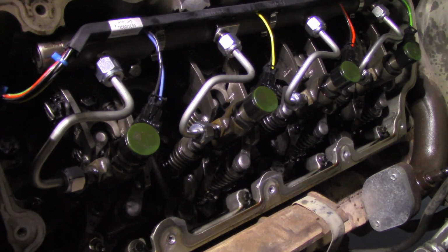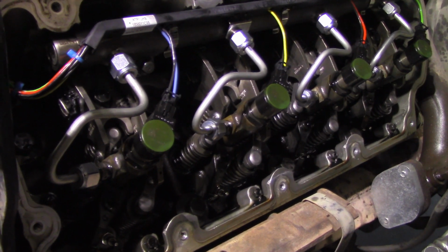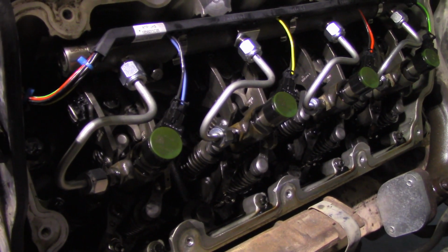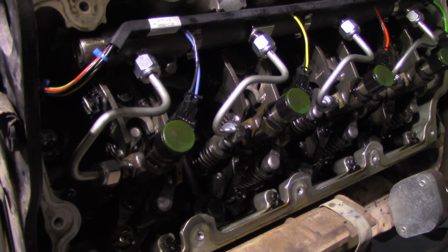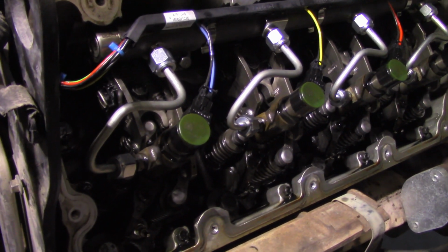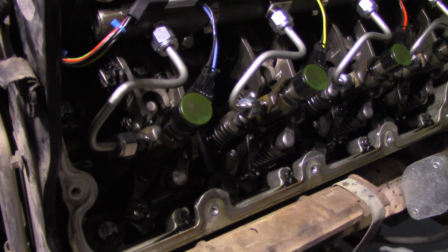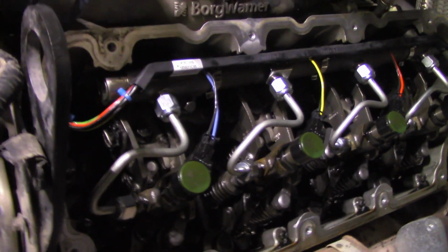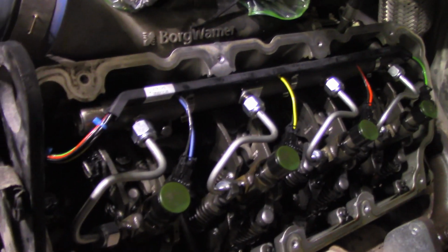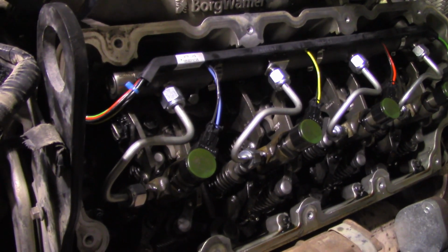So you go down to the crank pulley. There's 4 bolts in the crank pulley. There's no center bolt. There's 4 bolts, and you'll see a little roll pin hole with a roll pin in it. What you want to do is put that roll pin at 10:30 as you're looking back at the truck. So if you're standing in front of the truck looking at the engine, you want to put it at 10:30, which is basically where the bolts make a plus sign. So you want the bolts straight up and down, and then the other 2 straight across. That'll put that roll pin at 10:30.